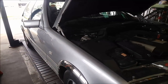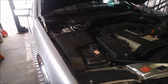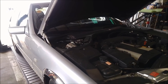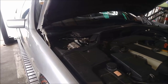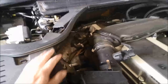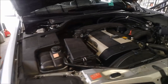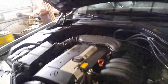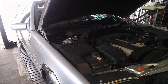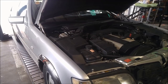G'day. We're doing a repair on a Mercedes S320, 1997 model, and it's got the 7226 five-speed automatic transmission in it. I've had the scanner on it and couldn't get any codes out of it, but what it's doing is it's got hard shifts through the gears and it's also hunting for gears. I've just popped off the little cap and checked the oil level — it was a little bit low, but probably not enough to cause that problem. It's an ex-government car and the owner has had it for quite a few years and has never done a service on it, so I'm suspecting possible contamination of the solenoids and the sensors on the conductor plate. We're going to go ahead and do the service and see what we find.